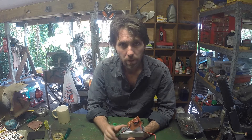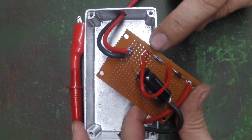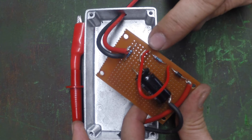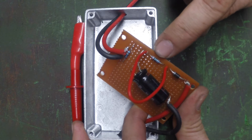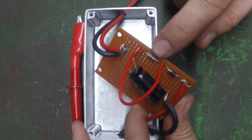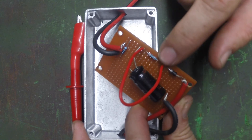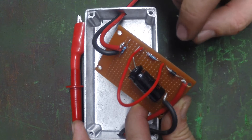I'll just bring it in a bit closer and show you what I'm gonna do. So if you saw the video on test ignition, you'll see what I did out in the field quickly — just have a jumper wire and bypass this resistor. Actually this wire is in parallel to it, so a small amount of current will proportionally run through this resistor, but the bulk comes through this straight-through wire, which gave us good results for the test.